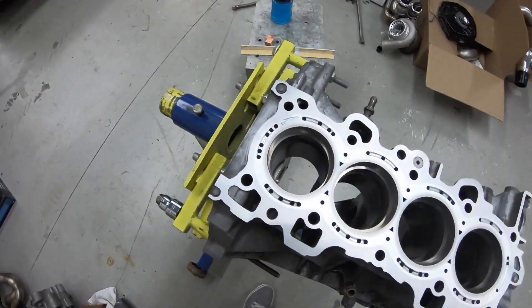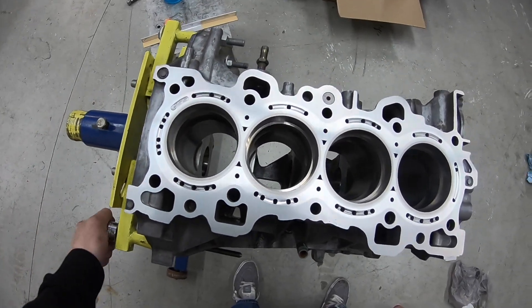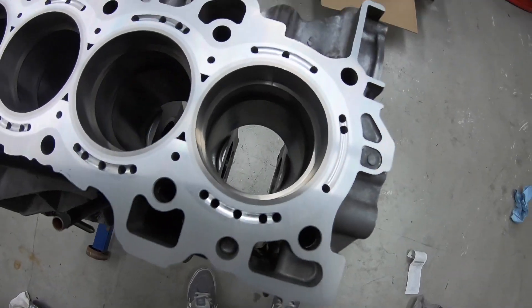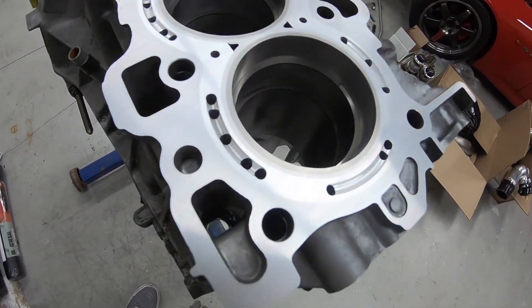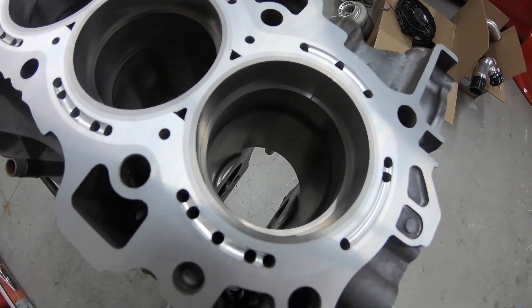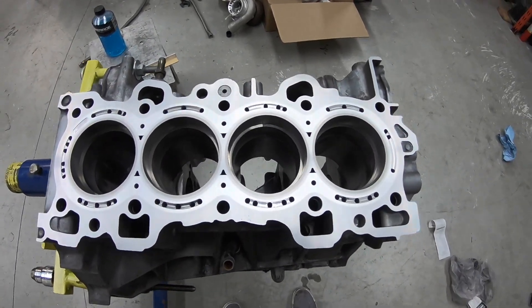This is the CSS block that I was supposed to put in the red car and it's 81.5mm. I already put all the rings in — the top ring and the second ring. I already gapped the first one just to feel it out and see how the ring file that I had worked.